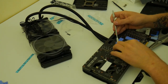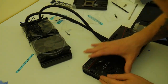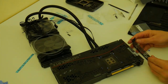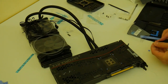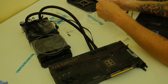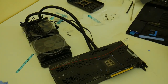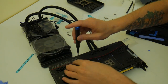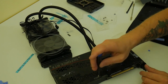Reinstall the I/O bracket and loosely fasten its three screws, then reinstall the back plate. As mentioned, 2mm thermal pads for the back plate don't come with the kit — I'll link some from Amazon in the description for about $10. If you want higher-end pads, feel free to justify that on a 3090.